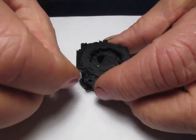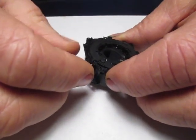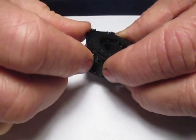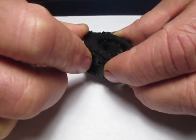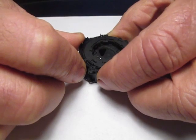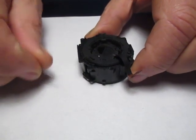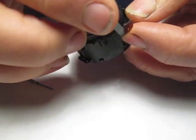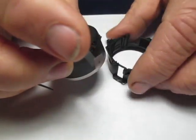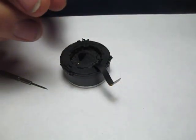In order to release all this, I'm going to rotate this as far as I can using a small screwdriver and indexing the gear. Be careful not to damage the gears. Now I'm going to index that as far as I can — you see that this plate popped up a little bit. That's the position where I can slide my whole extender group out of the outer housing. I'm going to lay that outer housing off to the side.